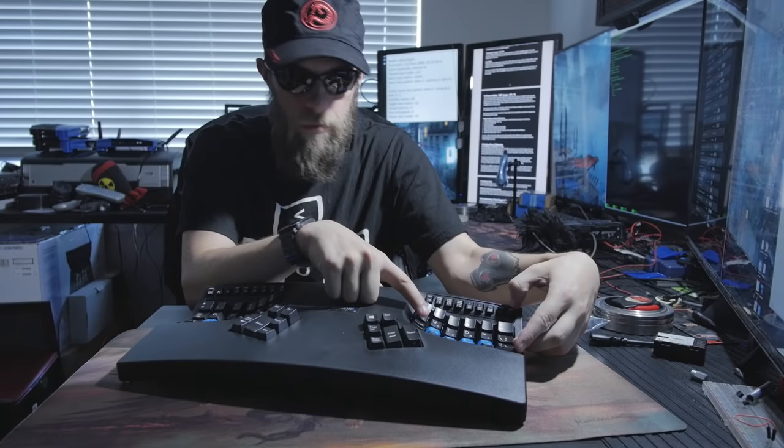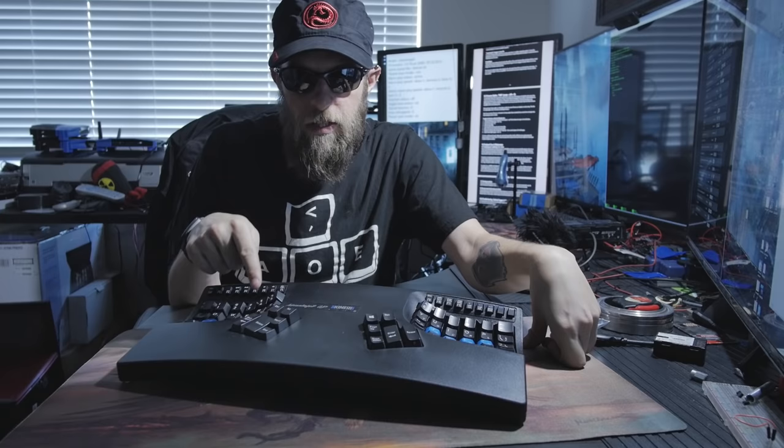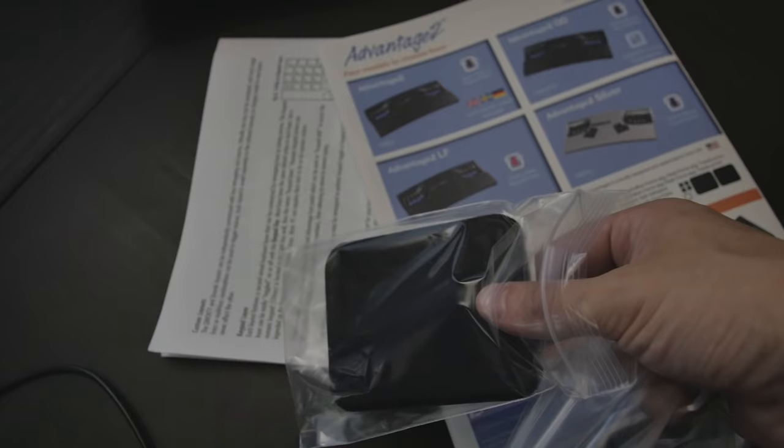From there, there are two folders. The one I want to touch on is the firmware folder, which is where you do firmware upgrades. The procedure is really simple: you copy the firmware file you get from Kinesis into that folder, make a copy of it, and change the copy's name to update.upd. Then you hit program, shift, and U for update. And I know what you're thinking — if I'm in Dvorak, will it be the U key? When I did it, it was the U key, which only Dvorak typers are going to understand. This keyboard is Dvorak right out of the box — it's fantastic.